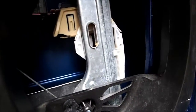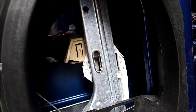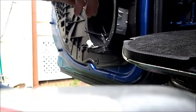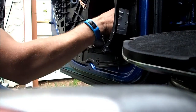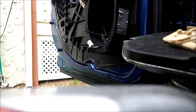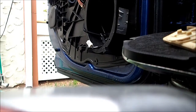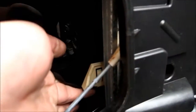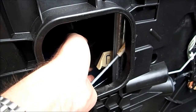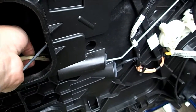It wasn't as hard as I thought it was going to be. Now I just have to remove those beige tabs, which have a locating dowel on them — pull them away from the window and then down to take them out. On the other side, I actually lifted the window up into the access panel that's in the door panel, and that enabled me to take that beige carrier saddle out. It just comes right out, just like that.